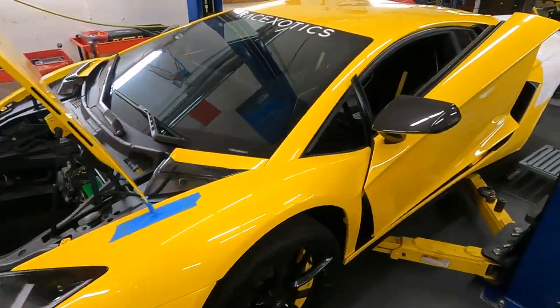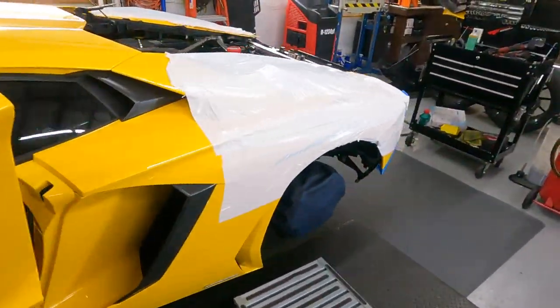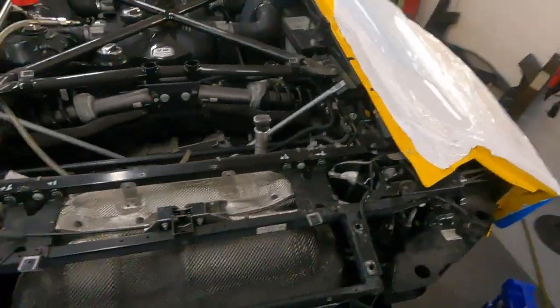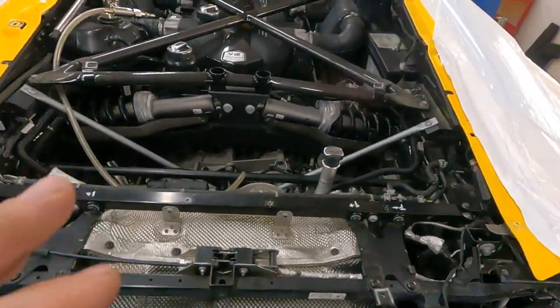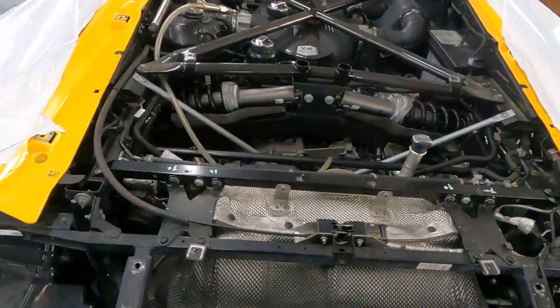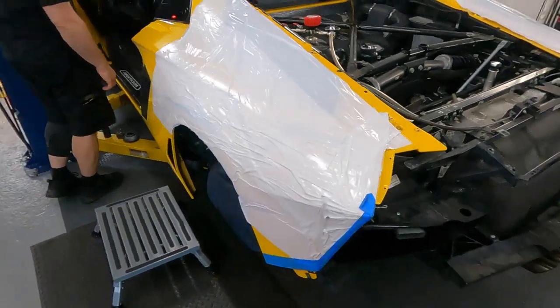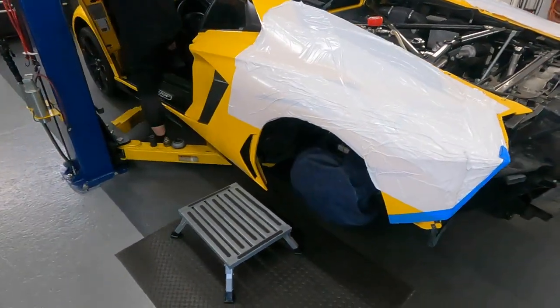Okay, time to fire up this guy. We filled 8 liters of engine oil. Normally it's like 11-12, but just for fire up, we are good. Okay, Alex, let's go fire up. Let me check if everything is good. We just fire up for like 10-15 seconds, because we are out of coolant.